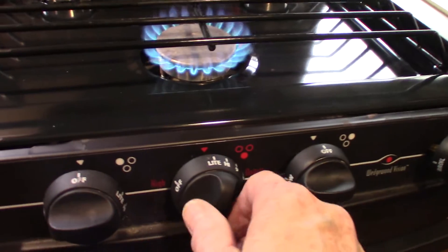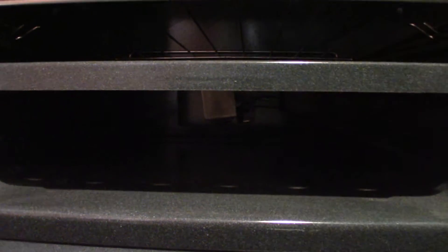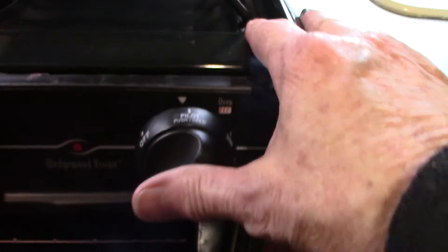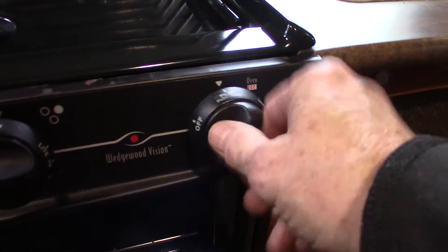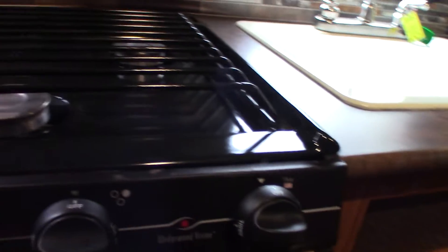It's that simple — you just turn it to light and then spark it by turning this clockwise and you're all set. The oven's a little different. You have to use a grill lighter with a long neck. At the back there's a pilot light at the bottom all the way to the back. You come to the knob and go to pilot, push and hold. Push it in and hold it while you light the pilot light. Once it lights, you still hold it for another 10 seconds or so to heat up the thermocouple, then go to operating temperature. Anytime you shut the oven off, the pilot light goes out, so you have to relight it each time you use the oven.